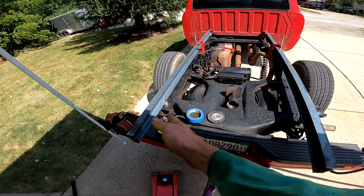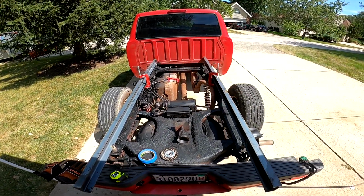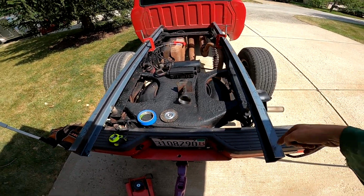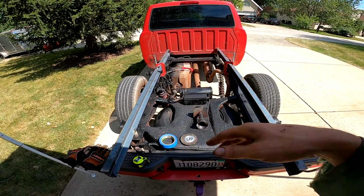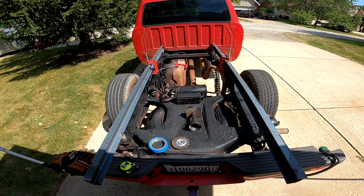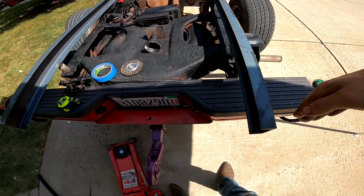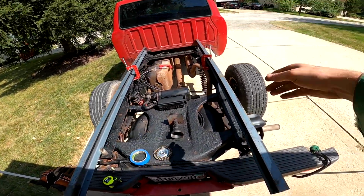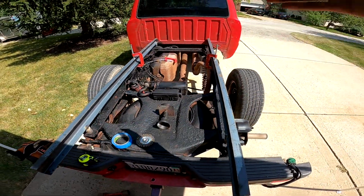All right, so I got the other rail done. Now I just got to square everything up. I just have them C-clamped in place, and so basically it's just going to be corner to corner, make sure everything's squared, and this way, and we should be roughly there. And then start cutting up the other tubes and angle iron, because I'm gonna have a piece of rectangle tube here, piece of rectangle tube up there, but this piece I'm gonna kick in, and we'll have our lengths.